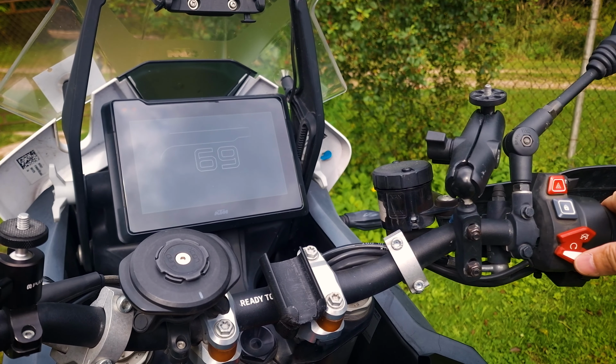Now we insert the needles directly into the connector of the sensor itself. I was interested to see what the oscilloscope will show just from the sensor. And there it is, just noise. It's more like some kind of alternator noise or something. I don't see any signal there for the computer to rely on.